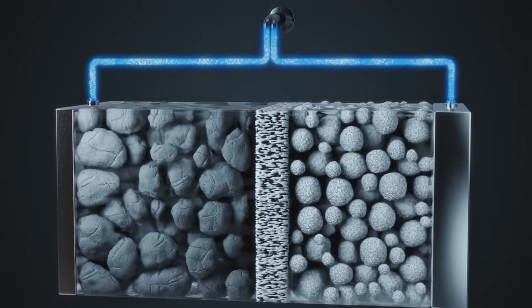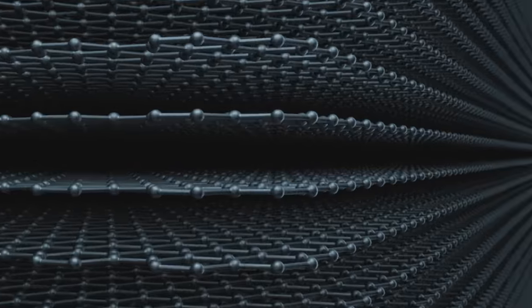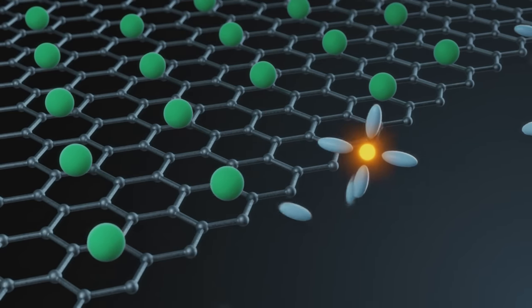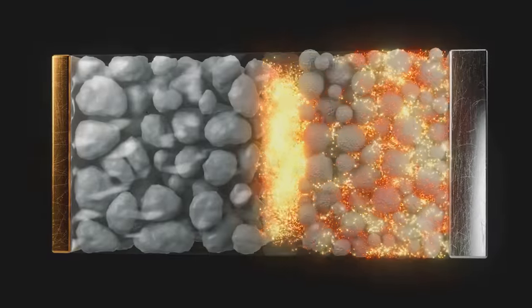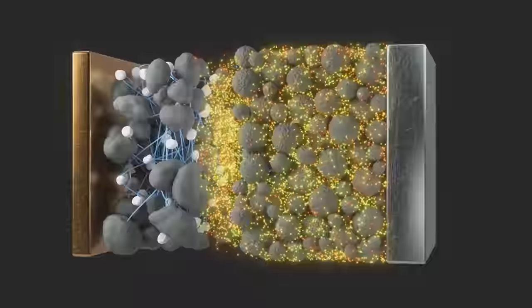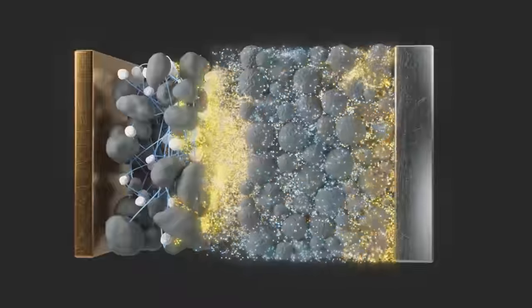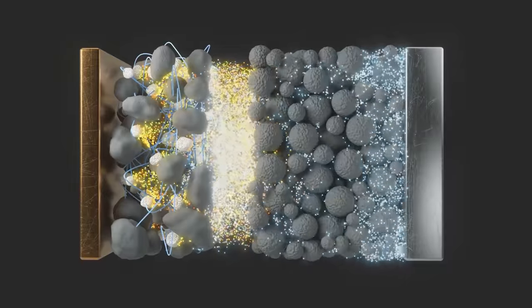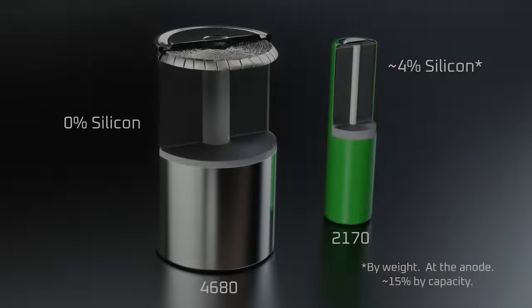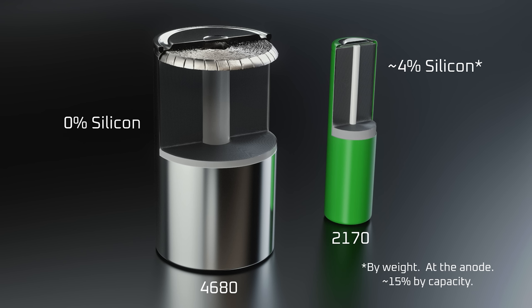Let's move on to charging speed. Another benefit silicon has over graphite is that it allows for faster charging rates. With a graphite anode, lithium ions scramble to find and enter empty spaces within the graphite host structure. This traffic jam becomes progressively worse as the battery charges, which is part of the reason why the charge rate becomes slower at higher states of charge. With silicon, the silicon particles rapidly soak up thousands of lithium ions each — like a sponge — and any traffic jam effect is minimal. This is where we start to see some unexpected behavior from Tesla's 4680 battery cell. We might have expected a silicon-free 4680 to have a slower charge rate than a vehicle using 2170 cells, because of more of a traffic jam due to the pure graphite anode.